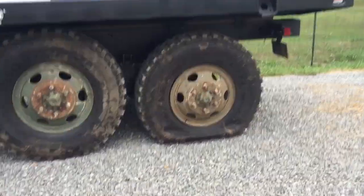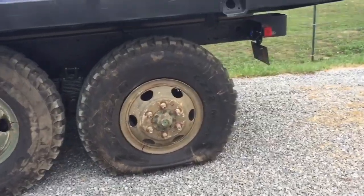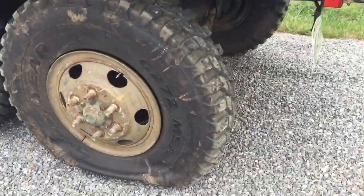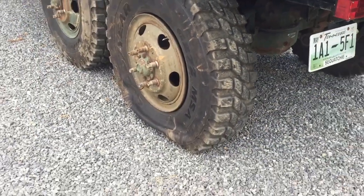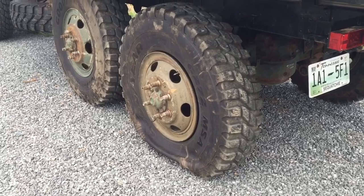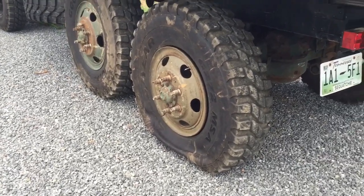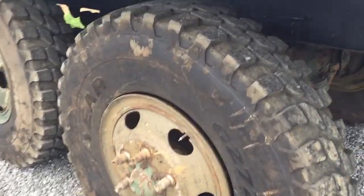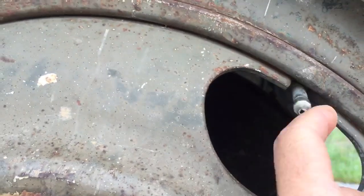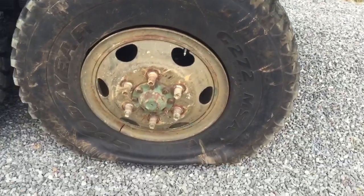But I got some bad news. I come home on Monday and notice a new tire is flat — pretty annoying, seeing as how I probably have about 200 miles on these things. I did air it up and it held for a little bit, but I could hear it leaking out of not the actual core but the valve stem itself, so that leads me to believe the tube is ruptured somewhere.